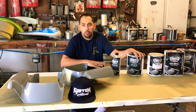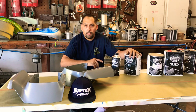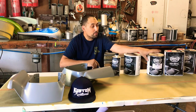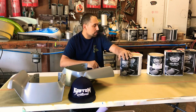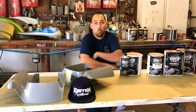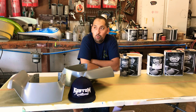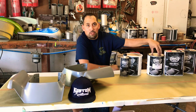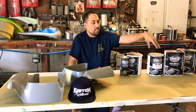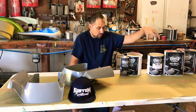A lot of you guys are used to the PPG products and the Chroma products from Axalta — this product will actually take the place of that on your shelf if you want. The epoxy is mixed one to one, not like your 5310 which is a four to one mix with its own hardener. The epoxy also has its own hardener, mixed one to one, and you get a large amount of material out on the substrate right away. That's for you bare metal guys, for those doing aluminum stuff — this is the product for long-term projects that have been sitting around for a year or two.